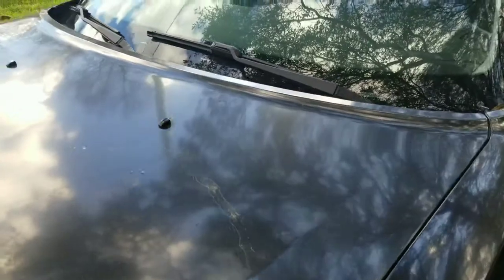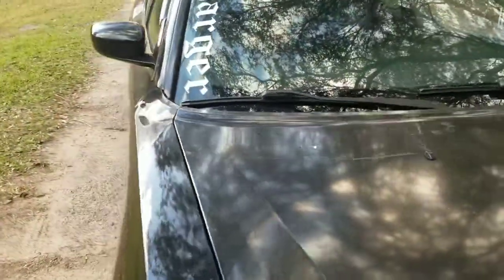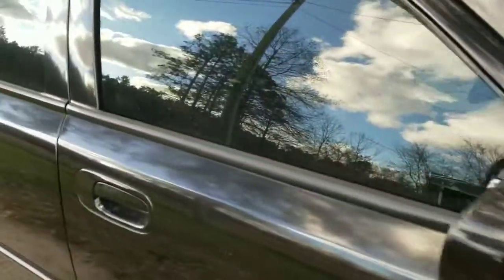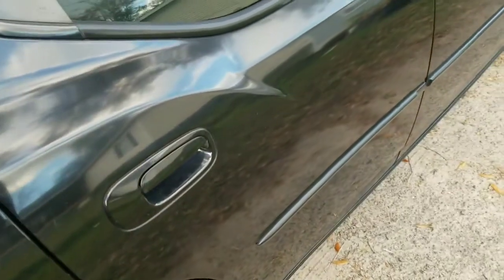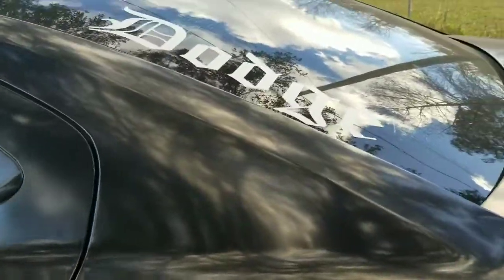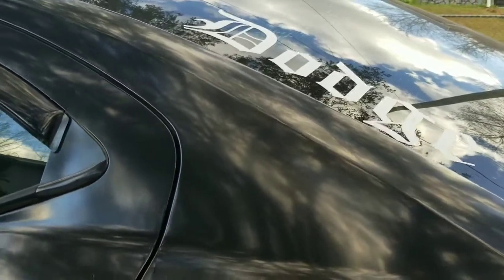issue when driving, when you're driving like 40 miles an hour. You could hear the rattling noise and kind of jerking and shaking and stuff like that. So the problem is gone, and also when you go like 60 miles per hour, it would kind of make it feel like it was shifting back and forth, but it wasn't actually shifting. But that's the torque converter issue.